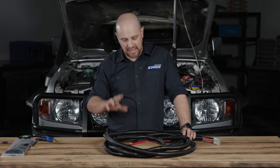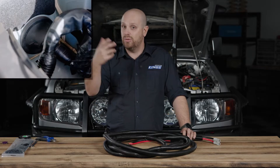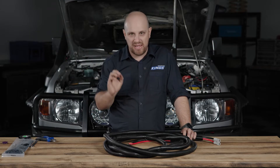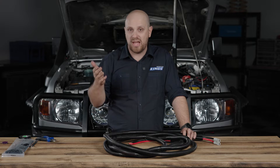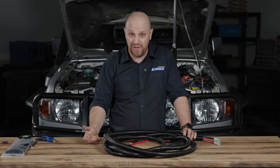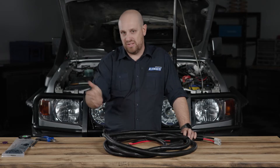There are two ways to get this cabling inside the vehicle. The first and most typical way is a firewall grommet. You'll need to poke a hole through it to feed your cabling through, but be careful — in most cases these grommets have all the factory wiring from the ECU passing through them. If you go in there with a knife and cut a couple of those cables, you will invent new languages to swear in. Go nice and slow, and once the cabling is through, a little dab of silicone to seal it back up is a good idea.